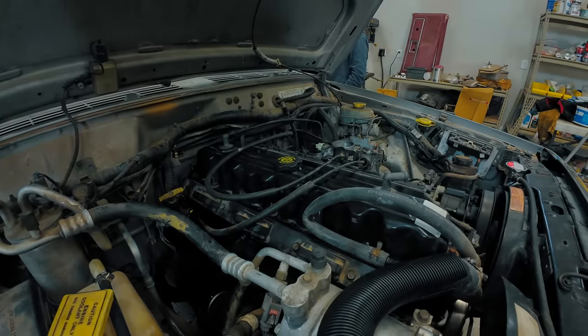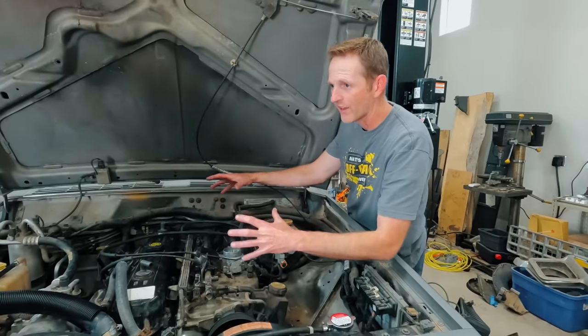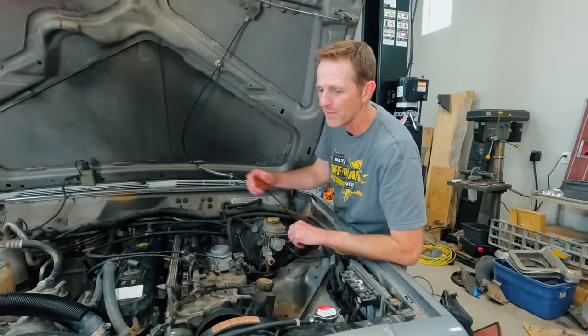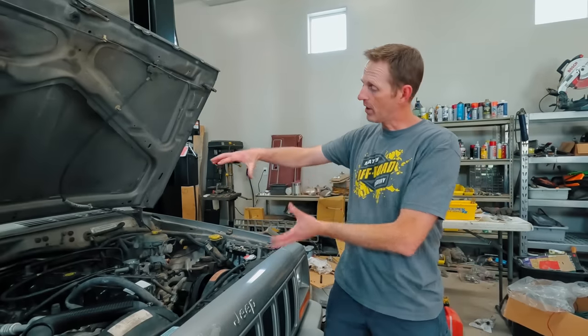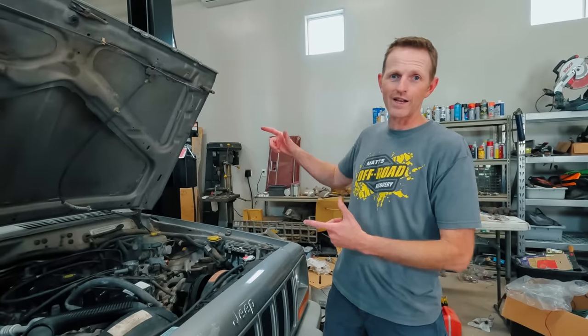It might not have had all the cylinders because of the air in the fuel line, but it calmed down and this sounds good right now. Let's take a look. There's gonna be a lot of stuff smoking off right here because my oily hands were all over the exhaust and the intake. So that's gonna burn and smoke for a minute. That was awesome, she's a runner. Now that I know it's gonna work, I'm gonna put all the air intake and we'll finish up some of these vacuum lines and stuff, and then we'll get out on a test drive.